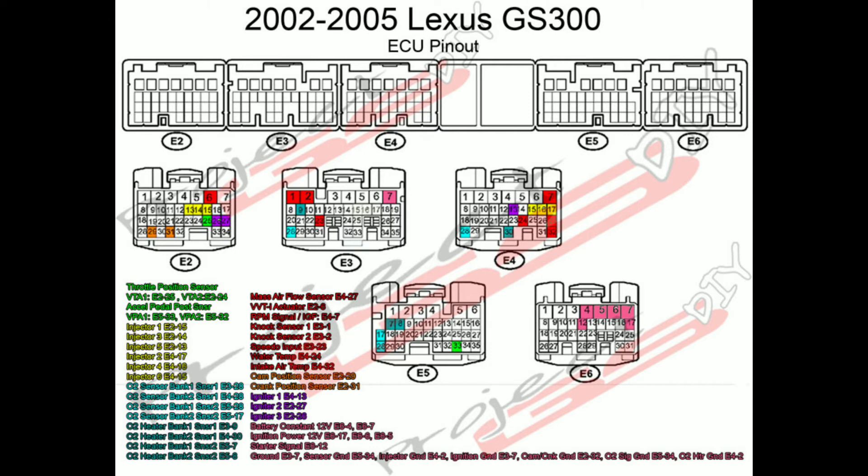Here are all the colors on the pin out in case you needed to see them all at once. All the other colors are signals and grounds — so that's a signal to your shift switch, or you can have it set up to your e-brake like mine is. I always do the ground wire to the battery just so it's a super solid ground, but you can run it anywhere else too.